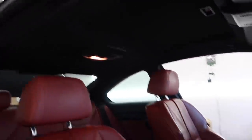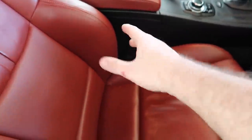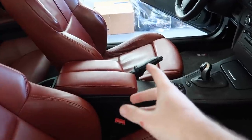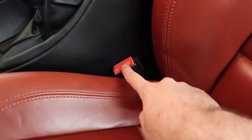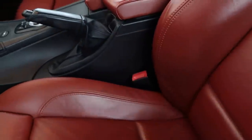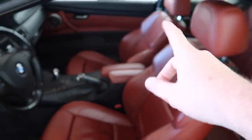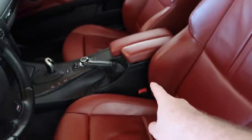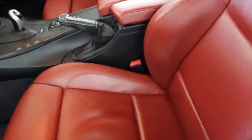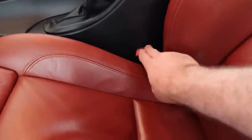It's officially complete. We got the curtain airbag inside, we got the driver's airbag inside, which means we should be able to just clear the lights and we're good to go. Hopefully fingers crossed we don't have any other issues with the seat buckles. Actually, we might have a seat buckle issue — look at the passenger side, that seat buckle's good, but on the other side that could be another reason why we have an airbag light. That one's tucked in compared to the other side — this was not as tucked in because this one blew in the accident. So we're going to have to cop a seat belt tensioner in the near future. Like the 335 IS, the curtain airbag deployed, the driver's airbag deployed, and the seat buckle tensioner deployed. We're good on the seat belt at least, but yes, we're going to have to buy a seat belt tensioner.